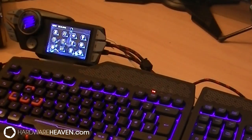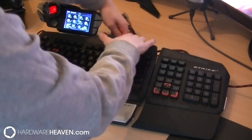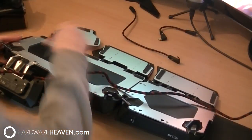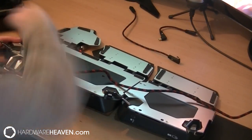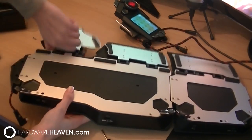Now let's go into how you build and dismantle this keyboard, as that is one of the really strong key features. I'm going to show you how to dismantle it and rebuild it into a Nostromo-style keypad format. First, remove the wires from all the components — this is four times faster than it actually took me, so bear with the slight blur. You then unscrew the screws in the back and pull out all the sections — you unscrew and pull out the metal piece attaching the top parts, and you do this for all parts along the keyboard.